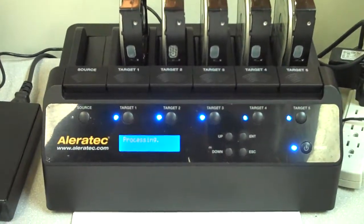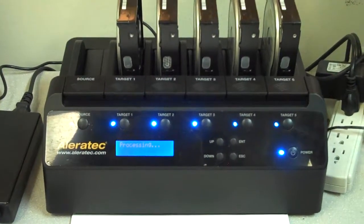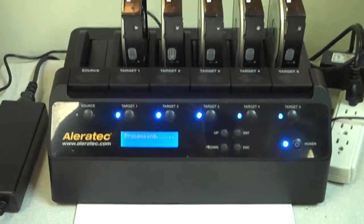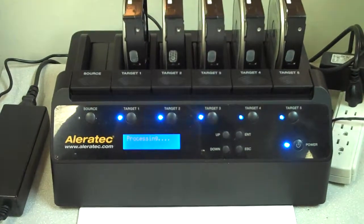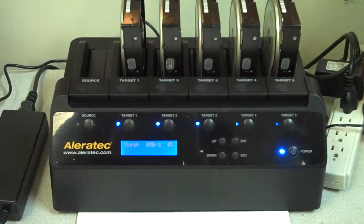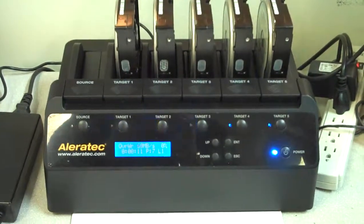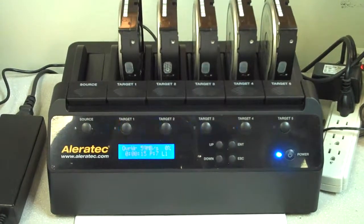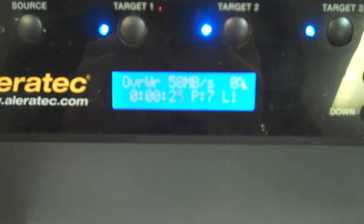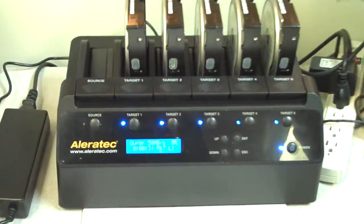You can see the blue lights flicker a little as it processes and checks the drives again. In a moment it will report back that it's beginning the wipe process on the five target drives. It will tell us it's on pass one and give a percentage of where it's at. The time it takes to wipe drives will vary based on the speed and manufacturer of the drive and the drive size. In this case we have 80-gigabyte SATA drives. Zooming in closer, it's telling you it's overwriting at 58 megabytes per second and giving you a clock showing how long it's been running. The 'P' indicates it will do seven passes and the 'L' indicates it's now on pass number one.